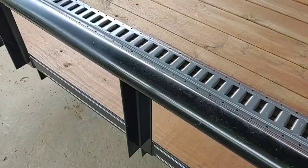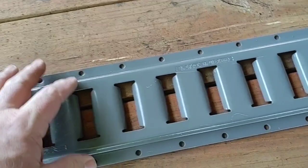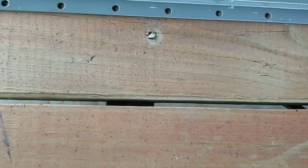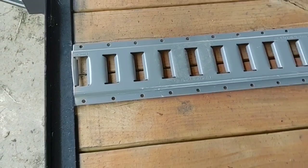I got the channels cut to fit down inside, and I got to measure to where the center of the wheels are going to be. When I fasten these down, a lot of people say just screw it with the wood, but I'm not going to do that — I will screw it with the wood some. Since I have access to a lift — my brother has a lift — where the frame is, I want to drill a hole and put a bolt through this and through the frame on each side. Then up here I want to put it up on the lift, and under there I want to weld a plate, probably until it comes back to about right here, somewhere right in that area underneath the bottom. Then I weld a plate over there and fasten that down, drill that, and fasten it through the plate.